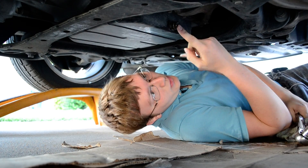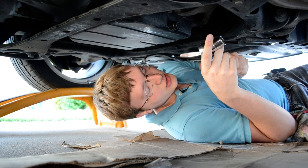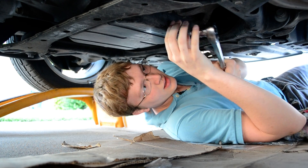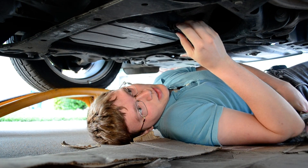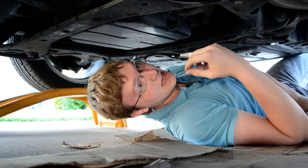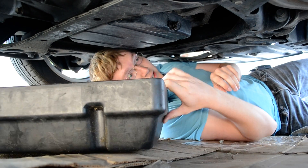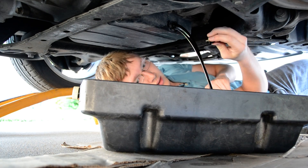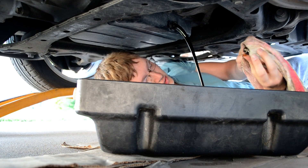This is the dirty part. You're going to want to find your oil drain plug, which is here on this car. You're going to take your wrench and make sure you have it set to lefty-loosey. Now, first it's going to be no big deal, but as soon as it comes out, hot oil — if the car's been running — or very cold oil is going to come gushing out. That's where the mess happens, so you want to be prepared for it. I'm going to slowly undo this by hand. I'm just going to wipe it clean. You don't want to get any junk on this because it can go back in the engine.